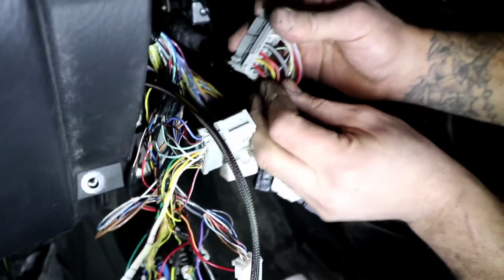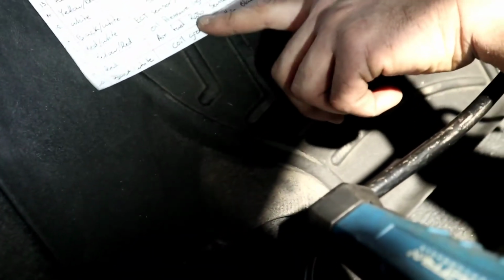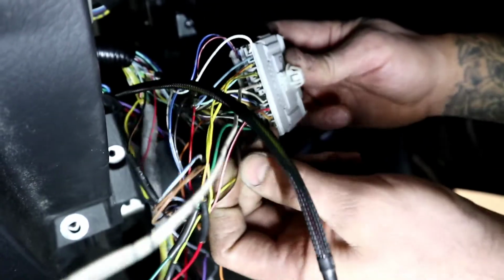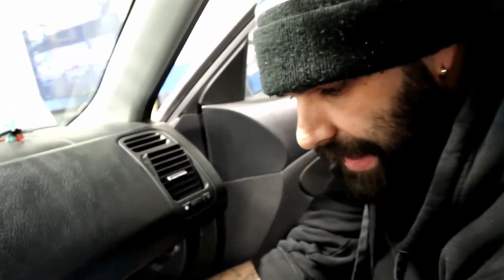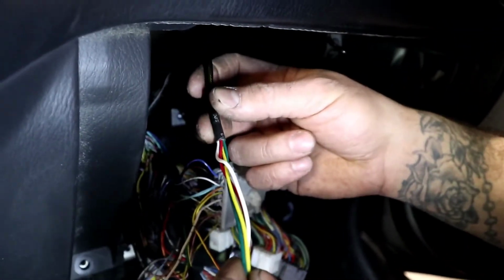19 on the engine harness side, it's a red wire. So that red wire is going to go to your air-fuel ratio sensor signal positive. This wire here, if you don't want to connect it right now because we haven't talked about it, you don't need to. You can just leave it. But on the engine harness side, it stays. It's this side here that needs to be wired up. So the next one over, I didn't have a red wire to install here, so what I did was I just installed a yellow-green wire. That's why it says yellow-green wire there. What that guy does is it connects to our wiring harness in the O2. So once again, it's going to be explained in the primary O2 sensor wiring.